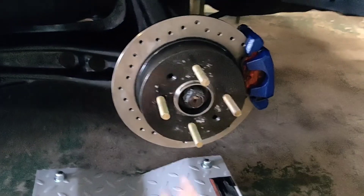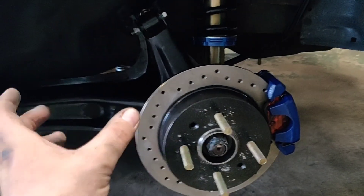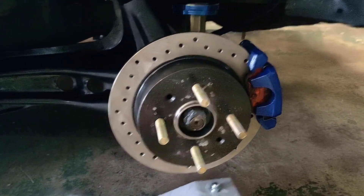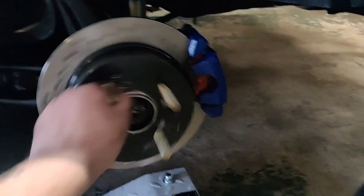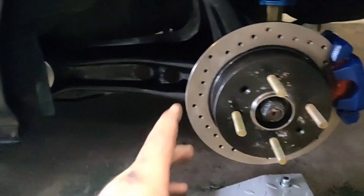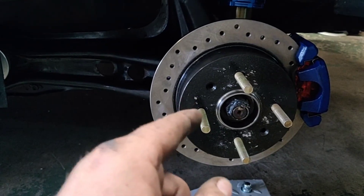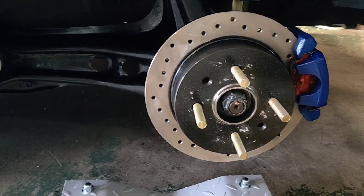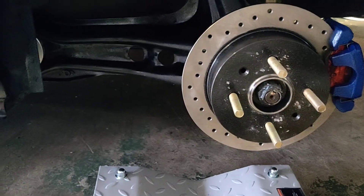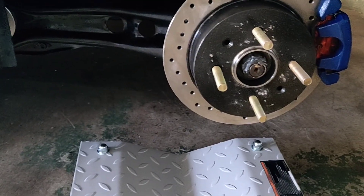I went ahead and got a rear brake setup — got the new rotors, got the new calipers. Obviously I'm not going to be running the parking brake cables and all that stuff. The stage brake has like a little lever, and I'll show you once I finally get that thing installed — it has a little lever that flips over, you pull it and flip that over and it kind of locks it into place, so you use the stage brake as your parking brake if need be. I went ahead and got the Scar Bird kit, so these trailing arms are actually drum trailing arms. The only thing I messed up on is I didn't clean where the backing plate was — I had a lot of rust, and I ended up breaking one of the bolts off. The impact just had too much torque and it kind of buckled the plate because the rust was there. I took it back off after I snapped it, realized there was a ton of rust, and cleaned it up. Now it's on there flat and I straightened out the plate.